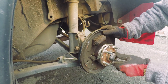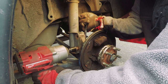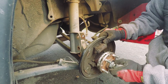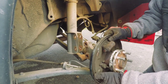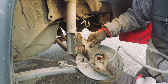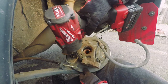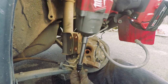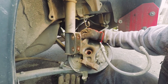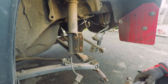I'm going to put the axle nut back on loosely so the whole hub doesn't fall out on me. Now that that's out, go ahead and remove that axle nut and support the back of the axle. I forgot to remove the ABS sensor, so we'll do that now — 12 mil bolt out, and the sensor should just wiggle out just like that. You can see that bearing was pretty shot.